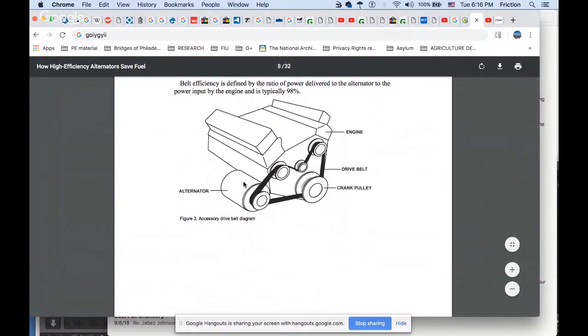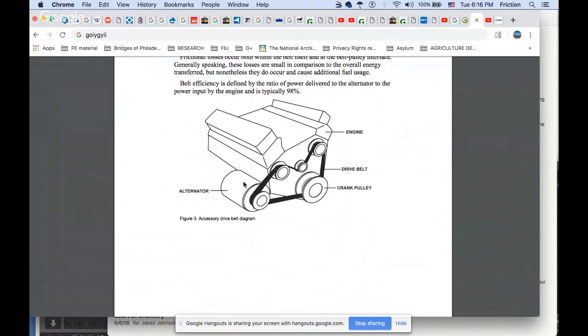The alternator, think of it again as a generator. While your car is running, it's generating all the electricity you need to keep all those things running: your brake lights, tail lights, headlights, turn signals, radio, all your electronics in your dash, all of it. And then think of the battery as the backup for that, temporary. It's actually to get you started, your cold cranking amps, your startup amps, things like that. It's being charged after you start the car up. Then it gets a trickle charge from the alternator, keeping it stable. But this is your power plant, your generator.